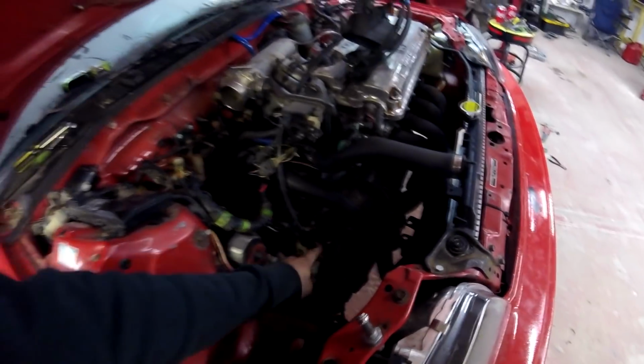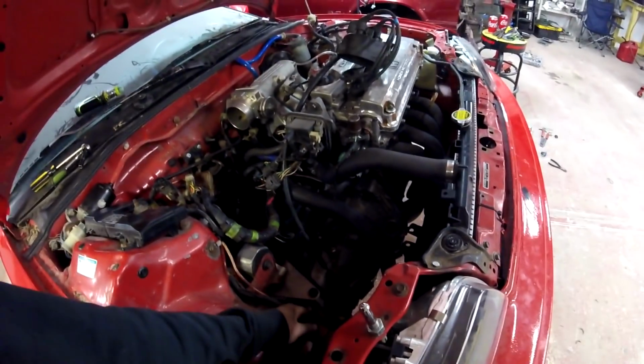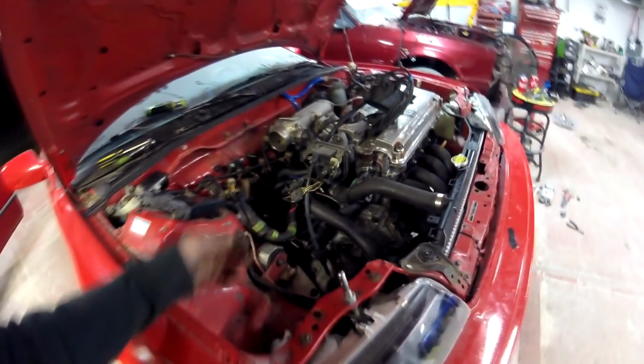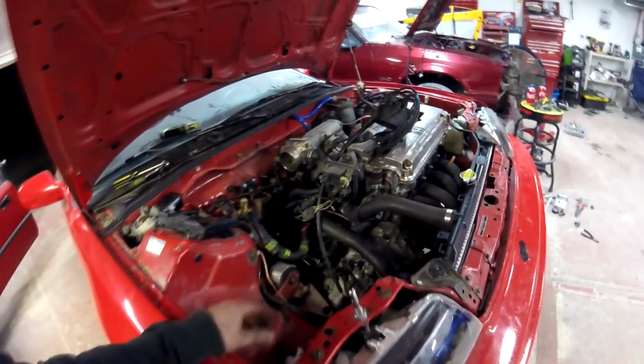And the clutch cable went on real good. I had a bracket for the B series cable transmission, and the stock clutch cable bolted right up. It is adjusted quite a far ways out. It doesn't have much adjustment left, but it is tensioned properly, and the clutch feels amazing. So that is good. I'm trying to think of some other stuff I did.